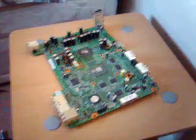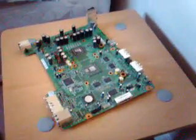you'll see there, I've put 7mm thick rubber blocks on these memory chips. 1, 2, 3, 4. Now when you put the Xbox back in the case, the rubber pushes the motherboard up and makes the solders go into contact better, because sometimes the solders come out of contact, and that does actually work. If you have error code 0020, that will probably help you, because I'm pretty sure that's what the problem is.